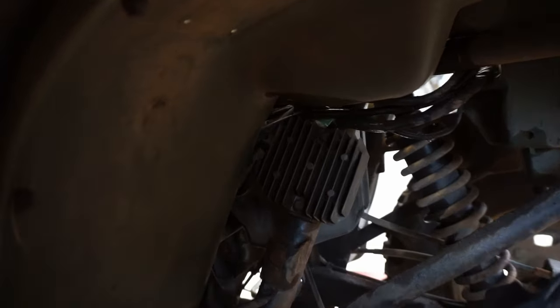All right, now the battery is reading 12.4 volts when the machine is not started. So let's start up the machine if we can. And then we'll see what that reading is. If it goes above 14.5, and it shoots up to like 16 when we rev it, we know it's the voltage regulator.